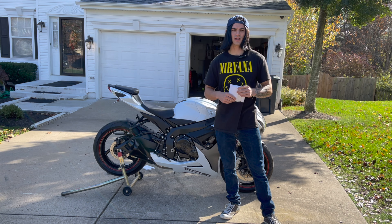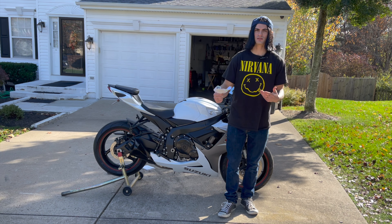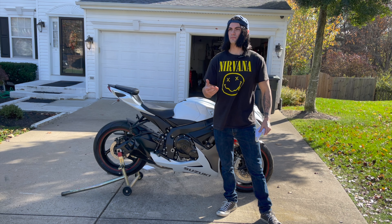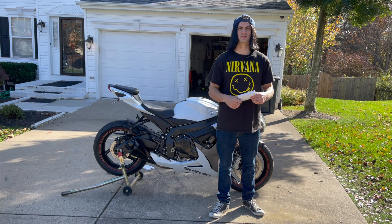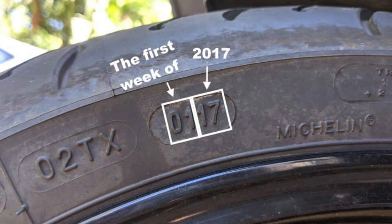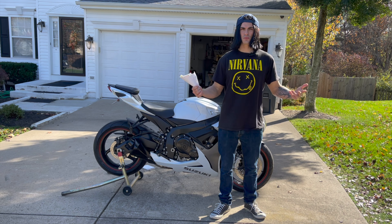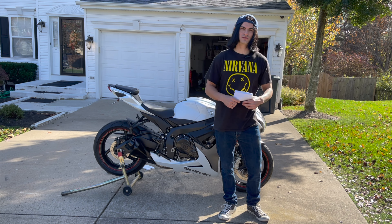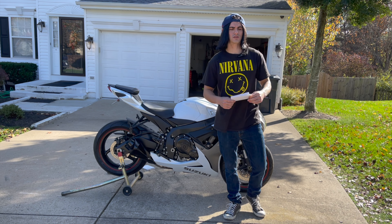When it comes to replacing the tires, check the middle of the tire because that's where it wears the quickest. For the penny test: flip a penny upside down and if you can see the full head of Abraham Lincoln it's probably time to start thinking about replacing your tires. On the sidewall it'll tell you the week and year the tire was made. If your tires are eight or ten years old just replace them — the general recommendation is every four or five years. Check the tread and make sure they're not cracked; a tire blowout on a motorcycle is pretty dangerous.